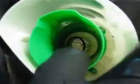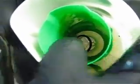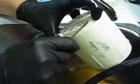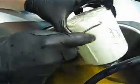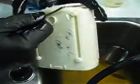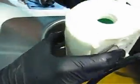So when you're installing this lower O-ring, I recommend dropping it in here, and then actually go ahead and put it around that bottom and then push the pump into it. That'll ensure that there's a proper seal there. And also, this is something that I've started doing whenever I install these: I go ahead and pop this filter off, which you just need to pick and just kind of chase it around. It'll just kind of pop out of place. And I'll show you why I do this here in a second. So go ahead and remove that.